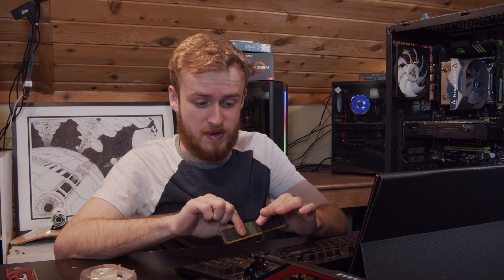Let's try this out with only a little bit of the bandwidth covered. I probably should plug in the HDMI cable — that'd probably be important. I know it's going to boot into Windows just fine. I'm going to go see if I can dig around the BIOS and see what mode it's running in. So it looks like it's running at 16X. This is a really poor BIOS. This is running at Gen 3 with X16. Tape remained on there the whole time.